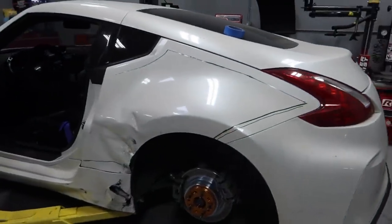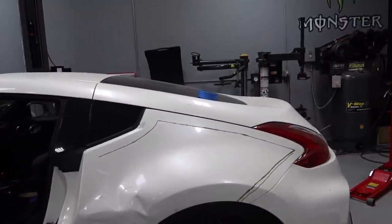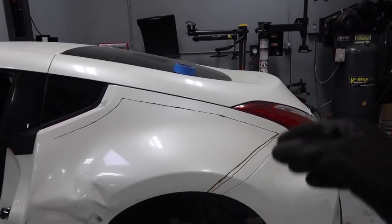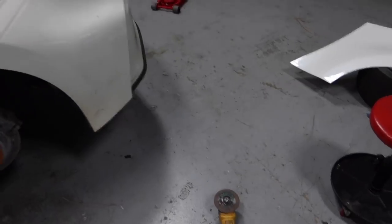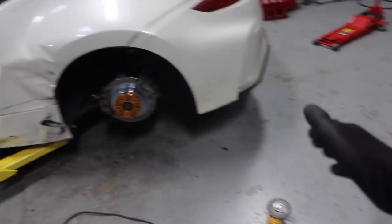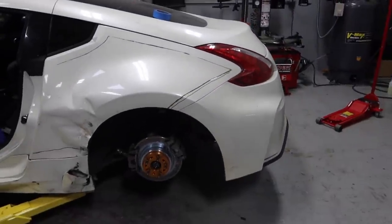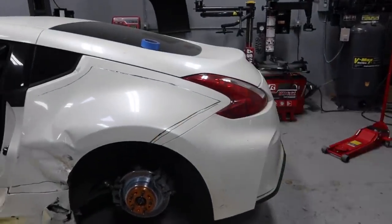A little trick tip I like to do with cars that are just track cars — where there's a little less precision needed — is to freehand draw the cut. I go in with the cutoff wheel and do a light cut, not penetrating anything, just scoring the surface to create an outline. Then I go back a second time and it cuts through like butter. It's important to let the tool do the work — don't overwork it. I used to force it through the first time; cut through it a few times instead.